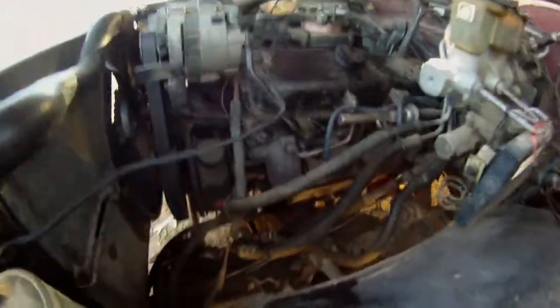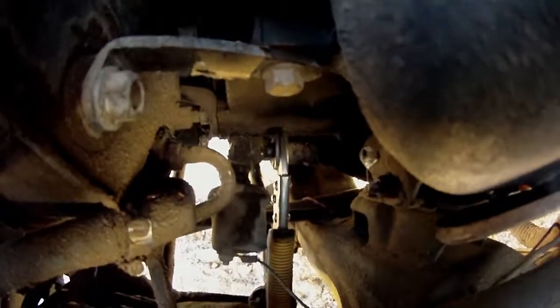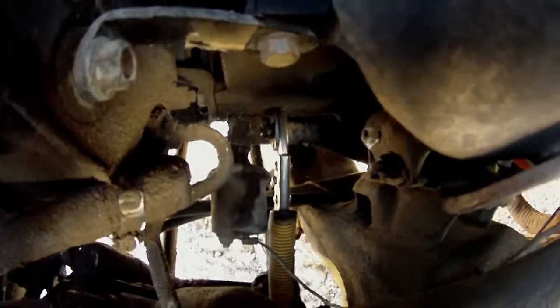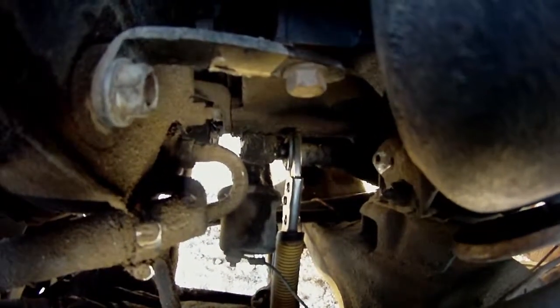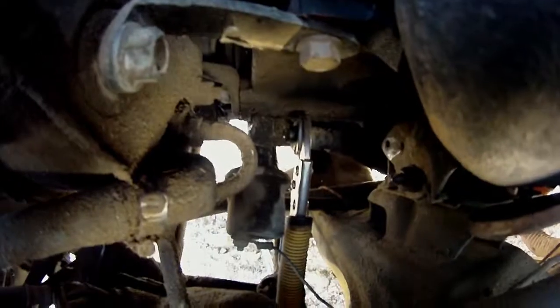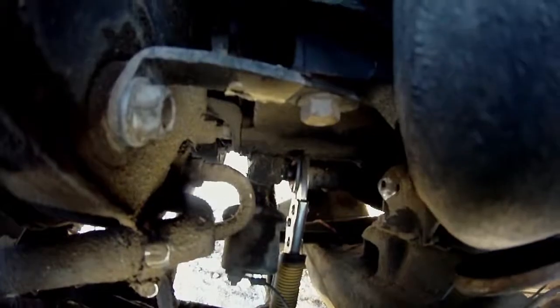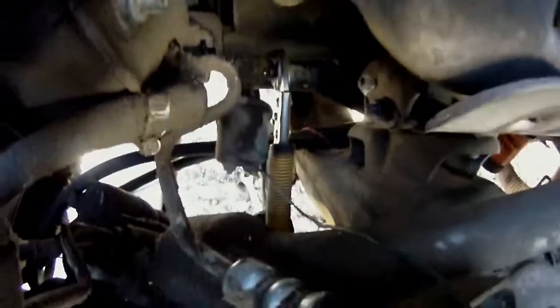So I'm going to test it with a mechanical gauge and see where we're at. Supposedly what's happening is there's a lot of dirt in that sensor. And you can see I got a vice grip. Everything's always got to be a little more complicated for me with old trucks like this — I'm sure this isn't the first engine, there's things that are going to be different. As you can see, I have two oil pressure sensors. One is the aftermarket, which I believe is the one towards the bottom of the screen there, and the one to the right I have the vice grips on — that's the one that comes off the wiring harness.